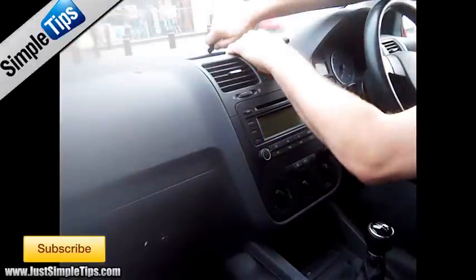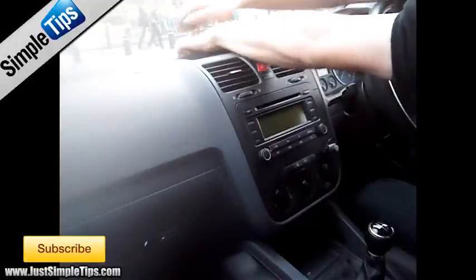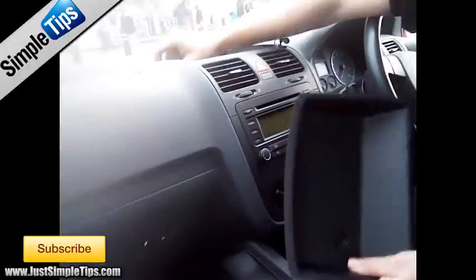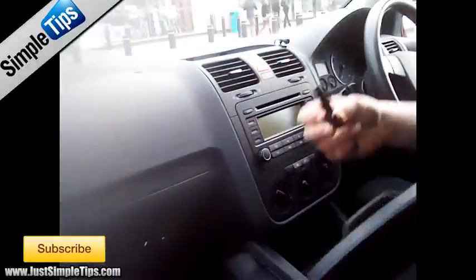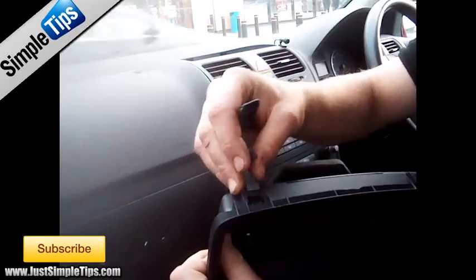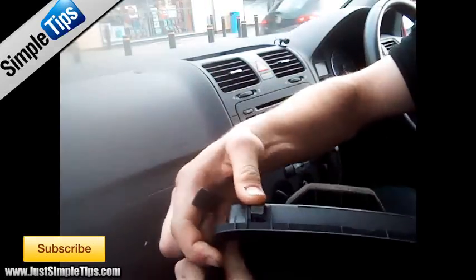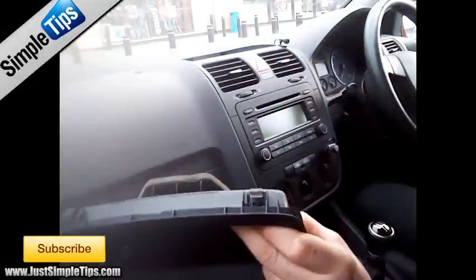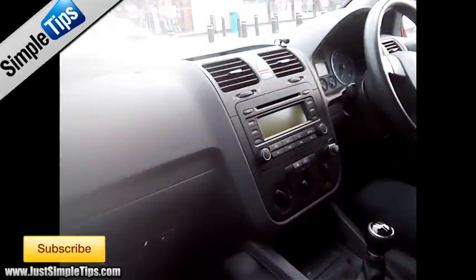Once they are removed we now need to lift up and remove the tray. Use your trim tool at the back just to lift it up. You will usually drop the two little clips — they will only fall off. They just push back into the back of the tray. It is very common for these to fall off, and unfortunately they can sometimes fall down the back of the dashboard, so just be gentle if possible.